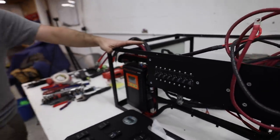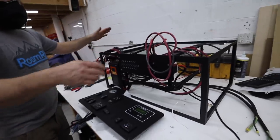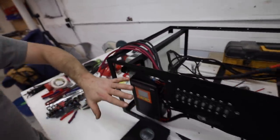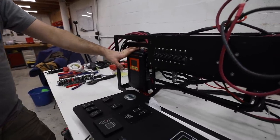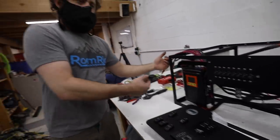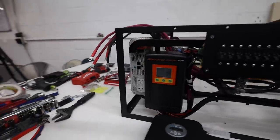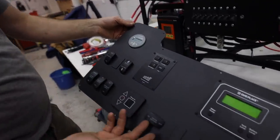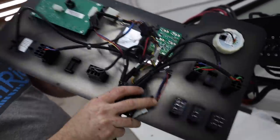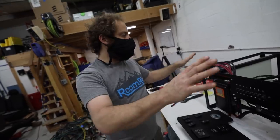We're getting ready to drop the system in. This is the entire replacement — that whole pile of wires and batteries and pieces everywhere gets replaced with this new steel bench frame. The batteries all sit in this space. There's a 3000-watt inverter and a 100-amp charger over here. This is the DC-to-DC converter for charging from the stock alternator — it's also the solar controller. Each battery has an individual circuit breaker. A nice thing about the way this is set up is you can take the bench seat panels on and off, so if you ever need to get to anything to work on it, you don't have to take everything apart — it's all right there. There's also a new control panel assembly; all the switches are labeled and actually tell you what they do. No more key for the bed. The panel is wired with a harness, so this just plugs into the harness that's already on the system itself — ships to the installer fully assembled, tested, kind of ready to go.